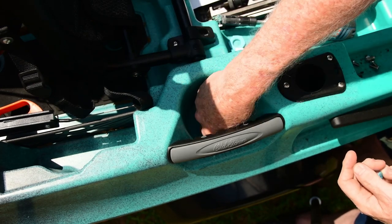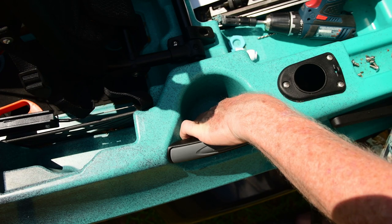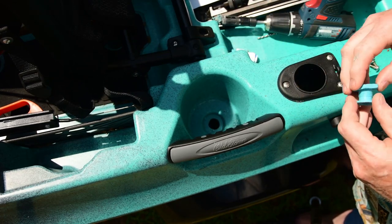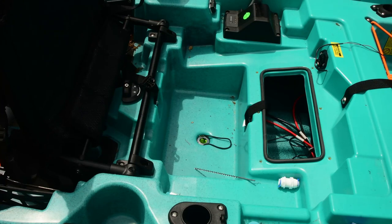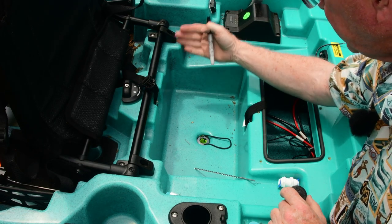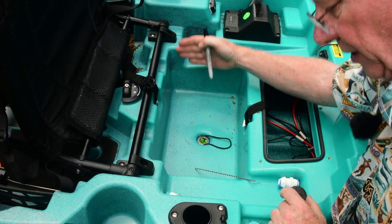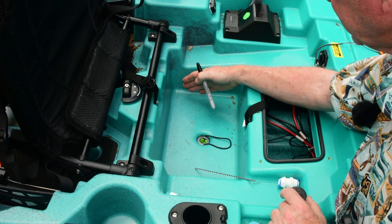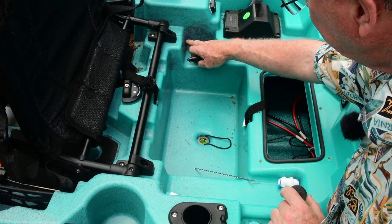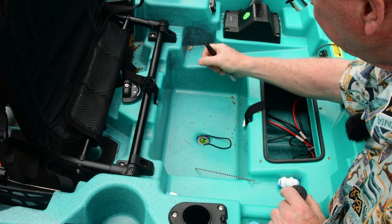Now we clean it up — it fits just fine, goes right in there. We're going to come back and put the adhesive on it, put the nut on the backside, and tighten it up. The next step is to drill a hole in this area — I prefer here. This is tapered inward so they can get it out of the mold. This sticks in a little bit farther. The battery holder is also tapered the same way. You want this down lower than where the cup holder is so it's going to drain out and you won't have water trapped in there.